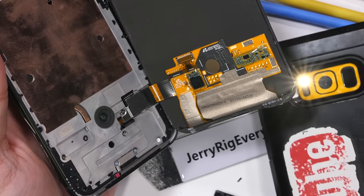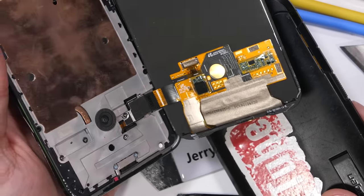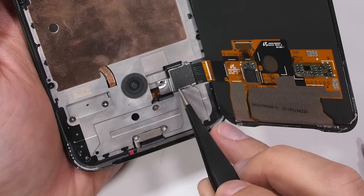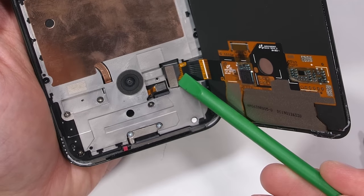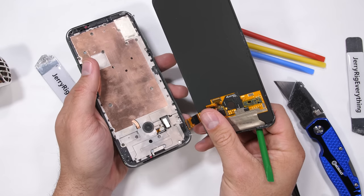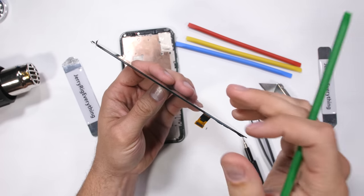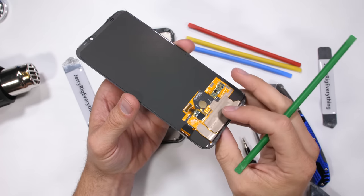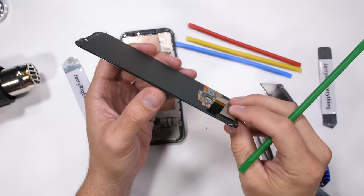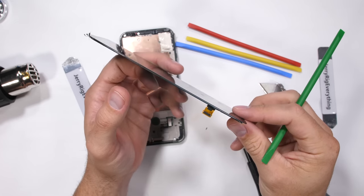You can see how the light from my S8 Plus shines through the hole in the display that the fingerprint scanner works through. One screw allows the silver screen connector bracket to remove, and then the screen can unplug like a little Lego. The display on the Black Shark 2 is an AMOLED, meaning that there's no backlight. This allows the whole thing to be super thin, exactly like what we saw on the Apple Watch 4. I wish more phones had a screen removal that was as easy as this. Unfortunately, the rest of this phone is a complete chaotic, unorganized nightmare inside. So buckle up.